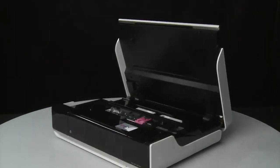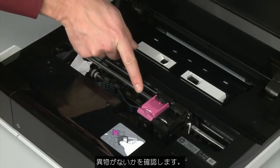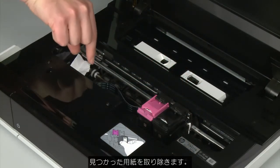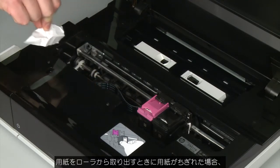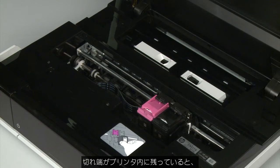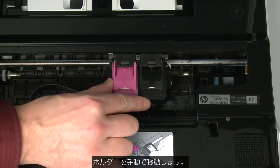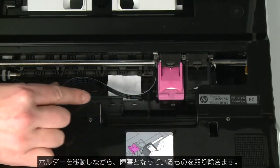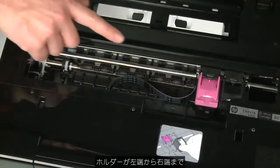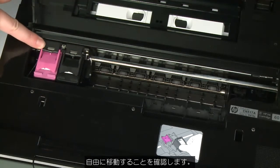Return to the front. Look inside the printer and check for paper or other obstructions around the carriage that could prevent it from moving. Remove any paper that is found. If the paper tears when you remove it from the rollers, check the rollers and wheels for torn pieces of paper that might remain inside the printer — if pieces remain, more jams are likely to occur. Reach inside the printer through the access door and then manually move the carriage. Remove any obstructions found while moving the carriage.